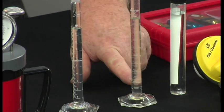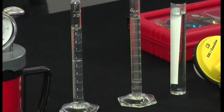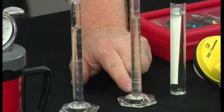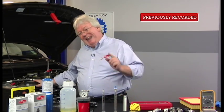As we let it settle, we see this one on your right is at 1 — actually it's a little above that, because it's E10. E10 is normal pump gas, so that will mix some of that water into the overall sample, because water is suspended in alcohol and the alcohol mixes with the gas. So it's raised from the 1 ml of water I put in up to almost 2 — about 1.7. So we have about E7, about 7% alcohol in the gasoline, which is quite acceptable for this Ford that's not flex fuel.